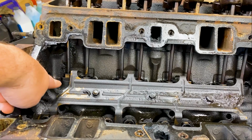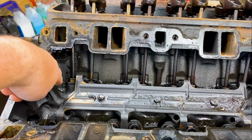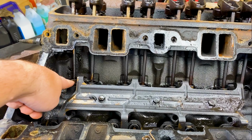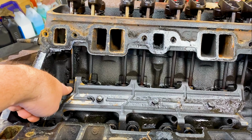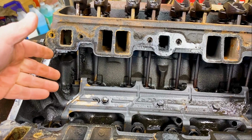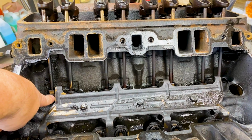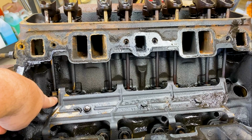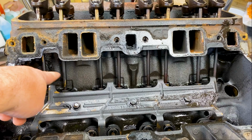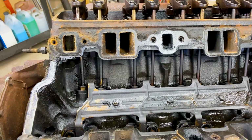And this is the block, and it's machined with a flat as well. This block is made for roller lifters. These are not supposed to spin. So because this is machined with a flat and the block has a flat, this block can accept these special kinds of roller lifters, so they're just not going to spin. My 350 does not have that. These openings on my old 350 are round. So that means you'd have to use a different set of lifters that has what they call a dog bone or a link between them that keeps the lifters registered with each other so they can't spin.